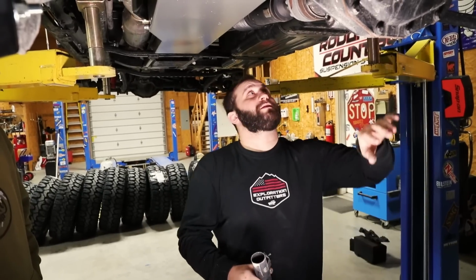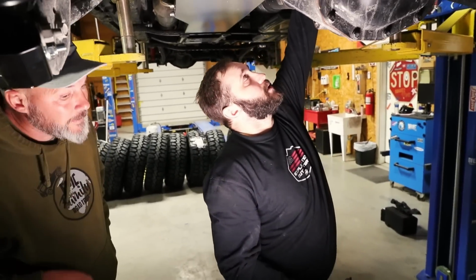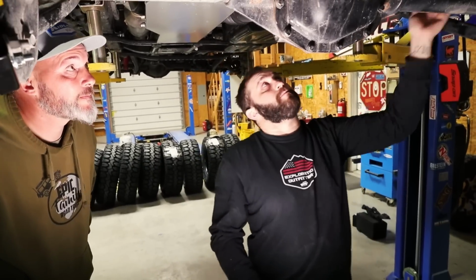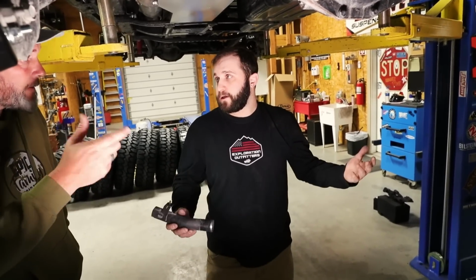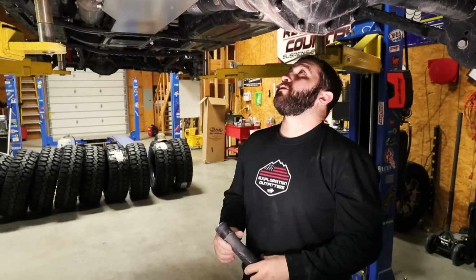You'll have to tie into the EVAP system. On the side of the tank here, there is a clip. Okay. You'll replace this hose. It runs out here to the outer fender. You'll replace that, and you'll put a 90 in on a rubber hose, and then you'll run that over at the top of the tank, and it allows venting for both of them. So you've got air and everything like that. So right, it's a pretty straightforward process. If you've ever done any type of auxiliary tanks, then you're going to know everything you got to do for it.